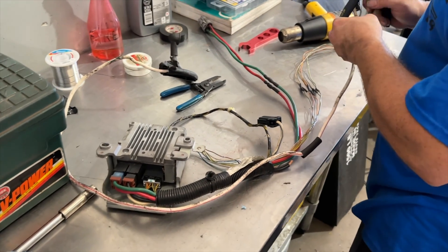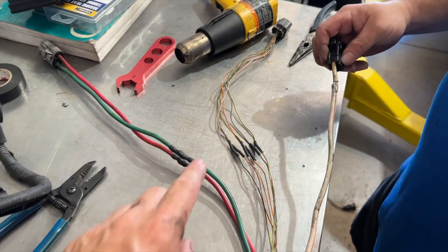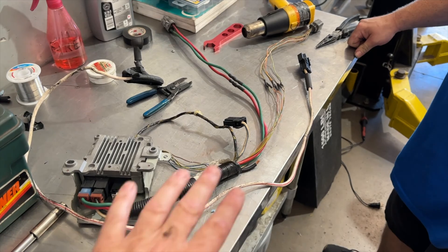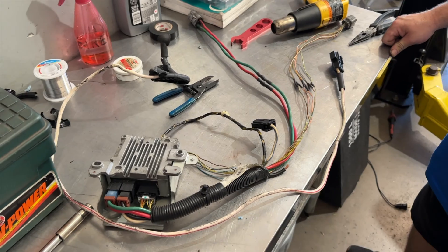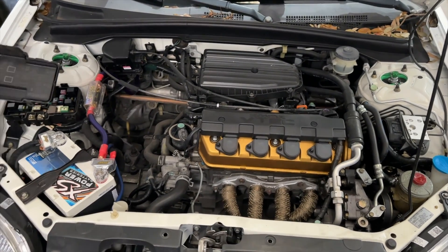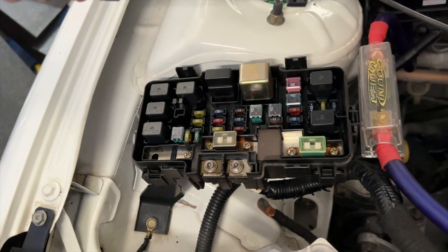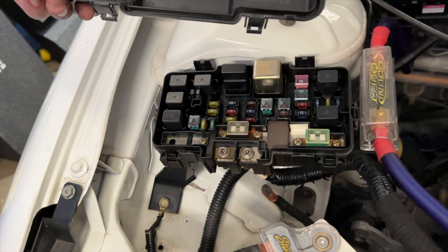The electrical portion was all pulled from the same donor car — you have to cut the wires to get it out, which gives you this part right here. We're adding a power wire, and we'll show you what pins you need. These will plug in, but we'll show you what you need to supply to make it work. In your fuse box it says EPS in the bottom corner — it's just a bare spot — so it's connected there electrically, and this is the end you're going to have to add to it.